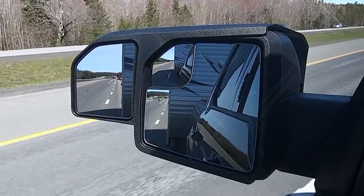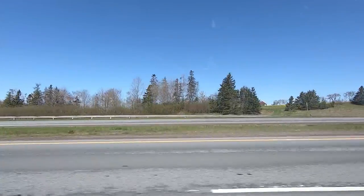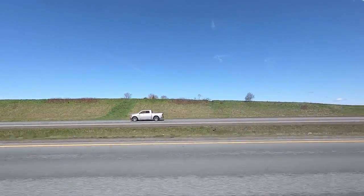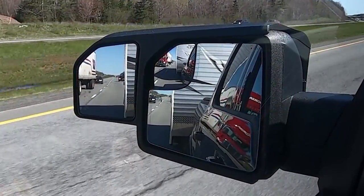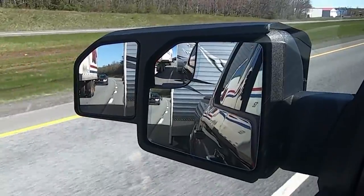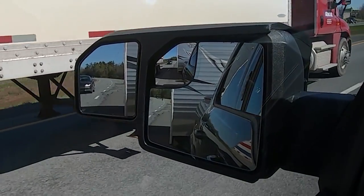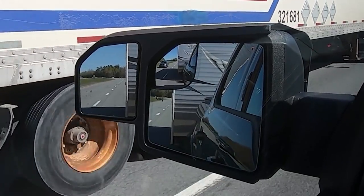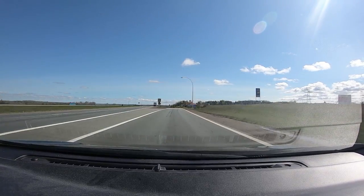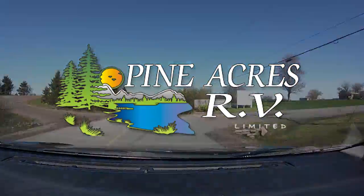As we're driving along here, I've got the camera on the side window just trying to monitor the amount of free play our trailer has. It's highly dependent not only on the amount of wind but the wind direction. I've got a tractor trailer coming up on my outside — an Armour trailer — so I know they're limited to 103 kilometers an hour. I'll back up to about a hundred, let him roll by, and see what experience I get. Sometimes you'll get some push off the front of a tractor, or suction off the back, or push off the side as well.